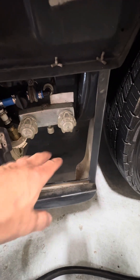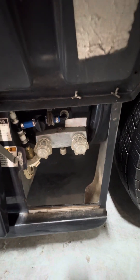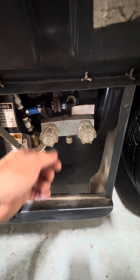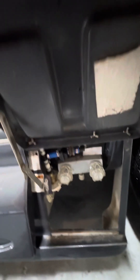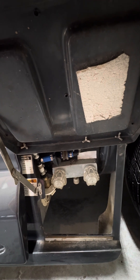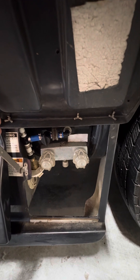You have an outdoor shower with hot and cold water, and there's a brand new hose inside the camper that you can screw onto this port. There is a little valve directly above it and your city water inlet. If you hook a garden hose to the city water inlet and open this valve so it's in-line, it will feed water to the fresh water tank and power-fill it. The drain for the fresh water tank is on the bottom, and for normal use the valve stays straight up and down to supply water to all your fixtures.